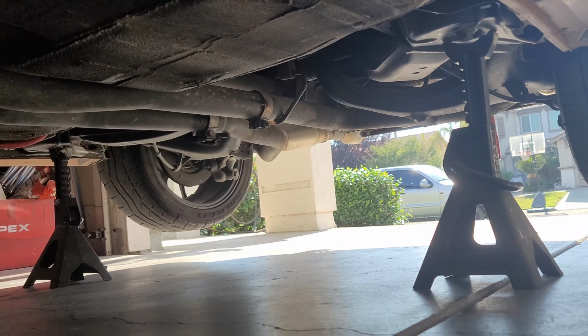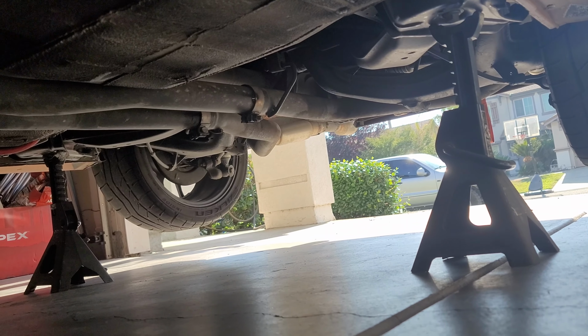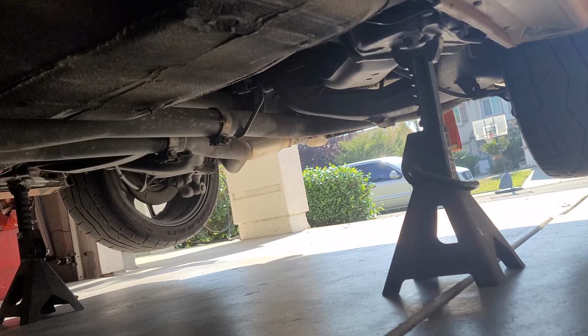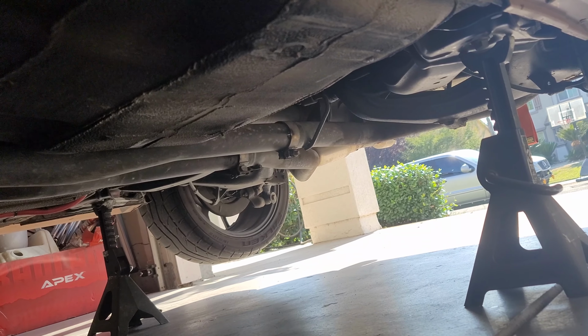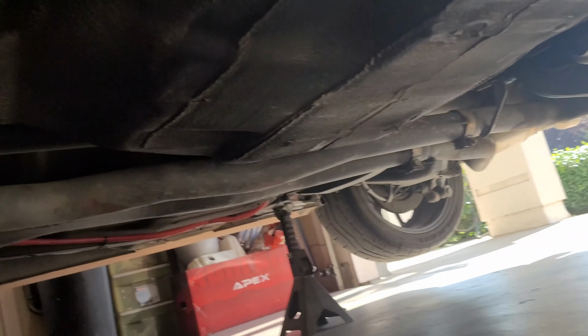It was 106 decibels, and there's no fun in getting kicked off the racetrack when you've already paid for all the sessions. And to be friendly to my neighbors, I put those on there. They still sound really good, but they do kind of limit the crackling, the popping. The initial startup's a little tamer.